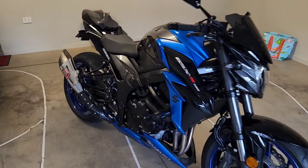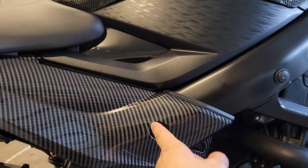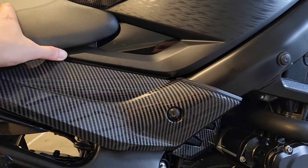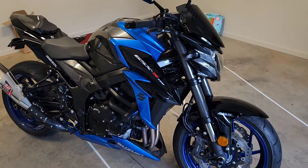The right side was 100% the same process. Just want to stress: don't use your drill and ram the screw in completely straight - it goes in on an angle towards the front of the bike. If you ram it in straight you're going to strip your thread and you'll be sorry.